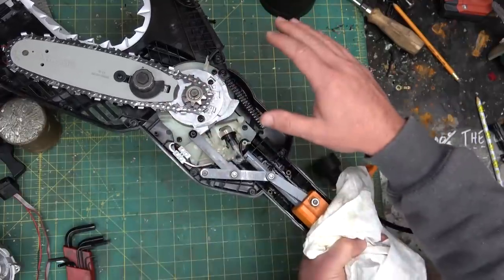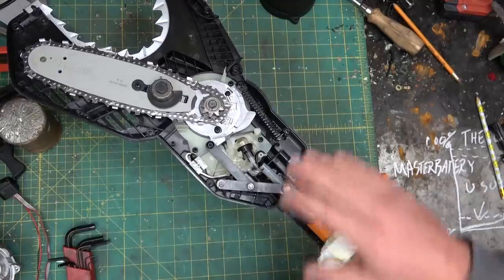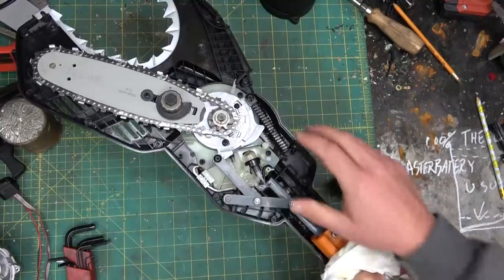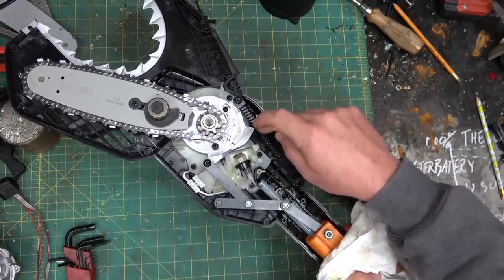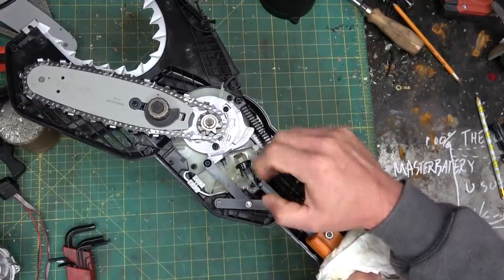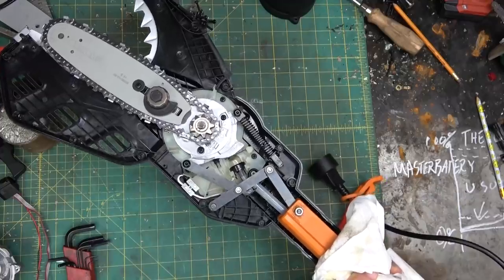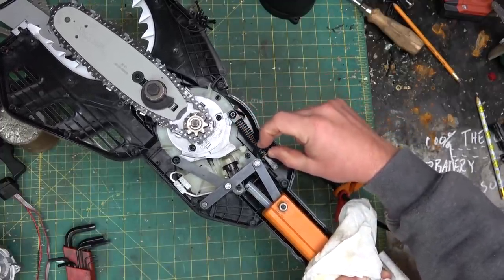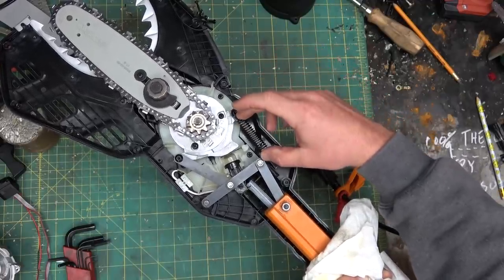It's terrible ergonomic design. Or ergonomic-less design. So what we've got here, and the other side of that, is we are spring released and arm strong applied. So you're getting through the cut, you're starting to cut, you're pushing. The further this spring moves, the further it compresses, the harder it is. Hooke's law, the more force coming out of it.